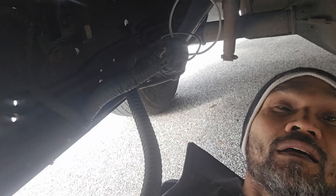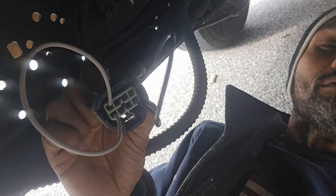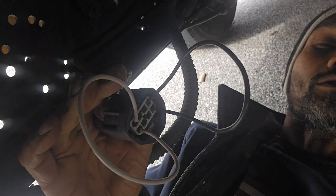It turned out to be exactly that. This is how you test it — as you can see right here, I've got two electrical wires to jump it, and that's the jump situation right here. That's how you test to see if the driver module is messed up. Right now I'm underneath the truck, so I've got plenty of room.